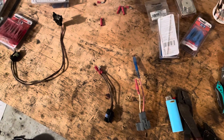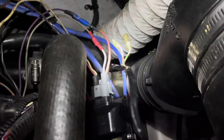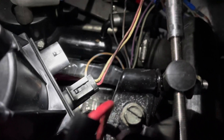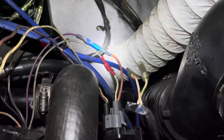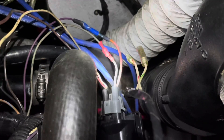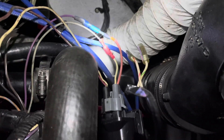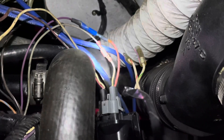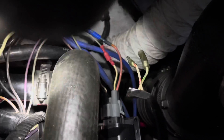I'm about to take these harnesses out and install them in the boat. I'm running out of light but I'll try to show you what I've done the best I can. There's the coil mounted. The first harness goes off the coil — the pink and white wire — and runs over and ties into the distributor right there. That's what's powering up the module and also what fires the coil. Then the gray connector goes in second and the pink wire is tied into the purple wire, which was part of the boat harness going to the old coil positive. So now the purple wire goes to the new coil's pink wire at its positive. The gray wire is tied into that white wire off the gray connector — that's what fires this coil and makes it run. That gray wire is also spliced inside the harness to go back to the tachometer at the front of the boat.